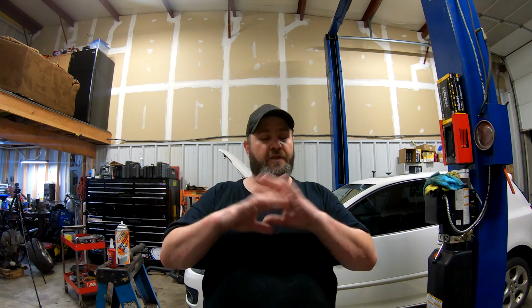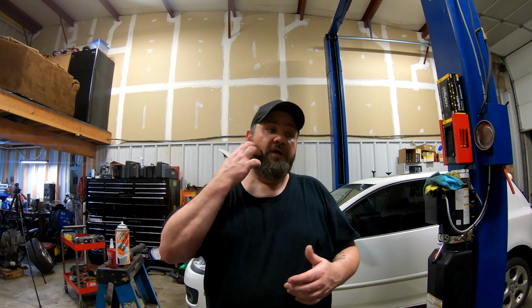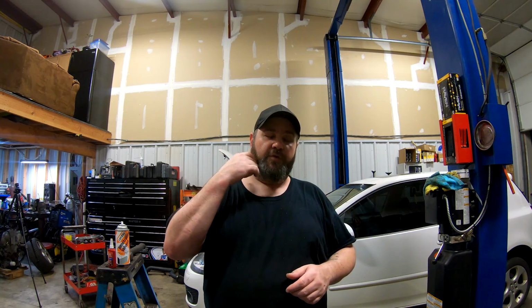This job on average takes about 5 to 6 hours, if you do everything by the book. And that's removing all the tubing, removing the axle, dropping the subframe, all that stuff. So it's really not a terrible job. You did notice that we did convert it from a dual mass flywheel to a single mass flywheel with a Spec Stage 2 maybe clutch. We also converted that rear main seal to a nice new piece, a nice billet aluminum piece with a normal everyday lip seal that is replaceable instead of having to replace the whole unit directly from Volkswagen.